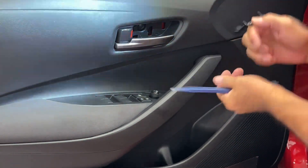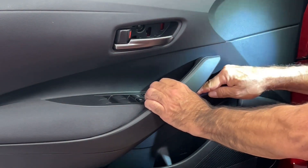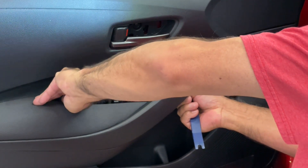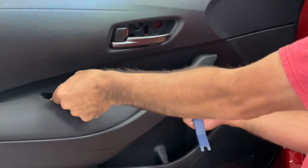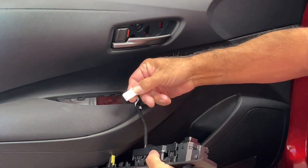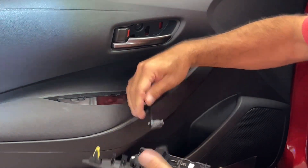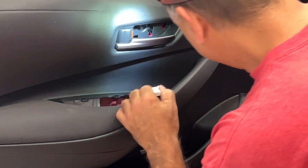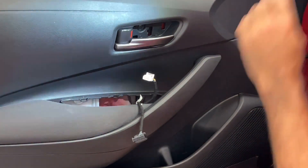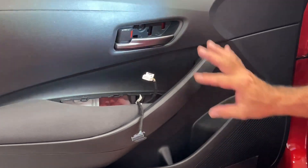Just pry — it snaps right out just like that. Then for the switch panel, the easiest place to pry is right here in the front. You want to just pry it up, and these all snap in place, so keep snapping all the way around the perimeter to the very back. Once you get that out, there's a push button on the plug right there. I'm just doing this to get it out of my way so I can get in here and work. On the GR Corolla, there's no padding behind the door panel. On the 2022 XSE, where we previously installed the same kit, there is padding, so it makes it a little more difficult, but that car has a little more sound deadening.